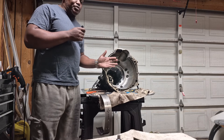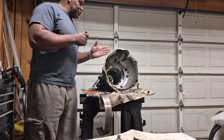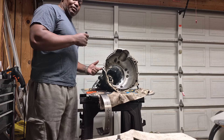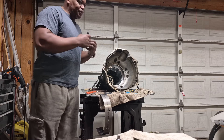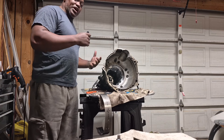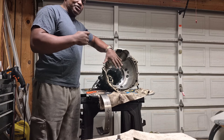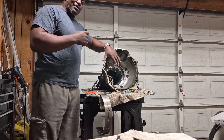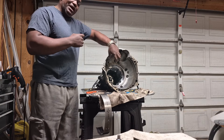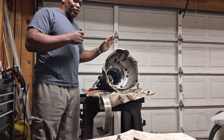With that little quarter-inch gap, if you try to match this bell housing up to the back of the engine, you're going to need bolts and you will try to use bolts to pull it together. Don't do that, because if you need bolts to squeeze the transmission to the bell housing, that means your pump is not seated properly and you're probably going to crush the pump. The little bearings and everything inside — you just made it a much bigger problem than what you got.